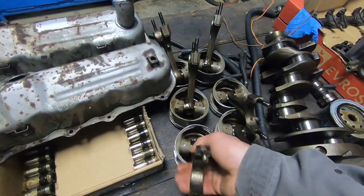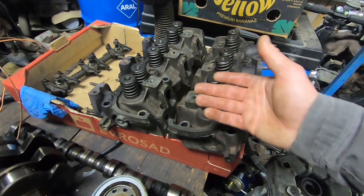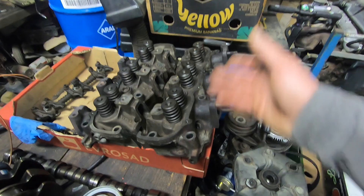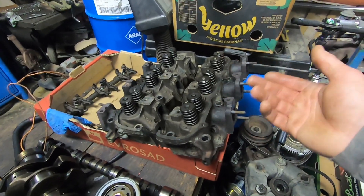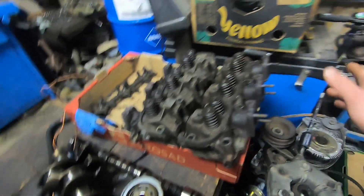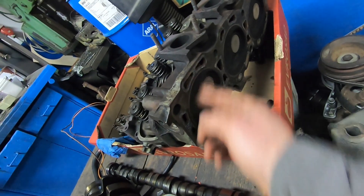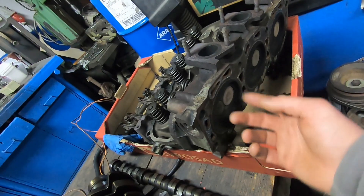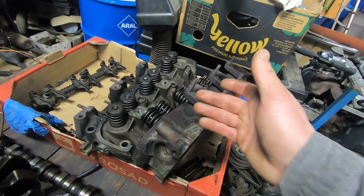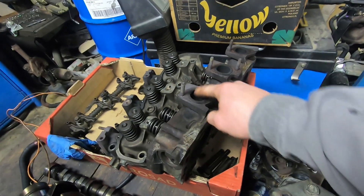The pistons are also in pretty good condition — they're showing really minimal signs of wear, so I'll be happy to reuse those. As the cause of the mixing of coolant and oil was actually the seal between the heads and the middle part here, I'm really not concerned with the heads leaking or anything. The head gaskets weren't showing any signs of leakage either. So the plan with the heads is to first test the valves for leakage by pouring some gasoline in and observing whether it pours out of the ports. If the heads pass the leakage test, I'm just gonna change the valve stem seals and maybe do a little bit of porting.